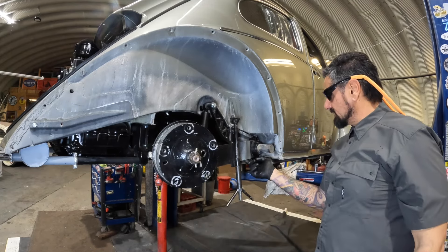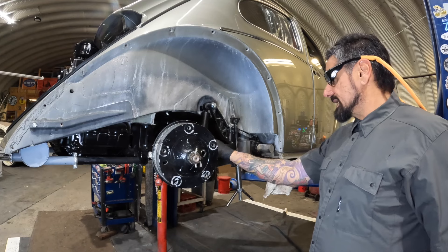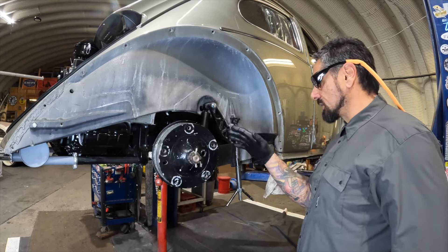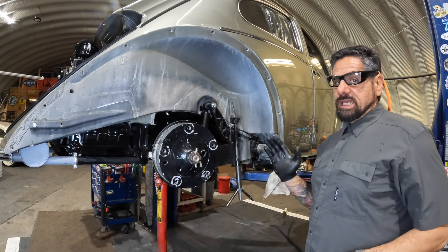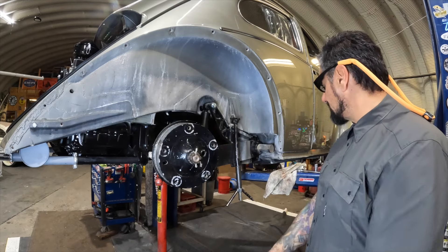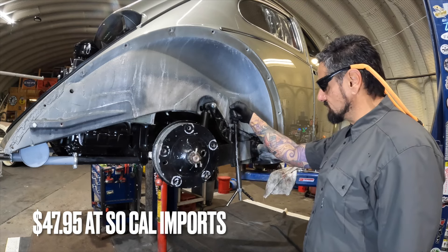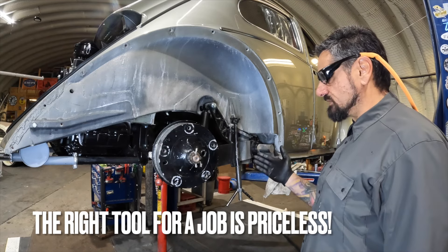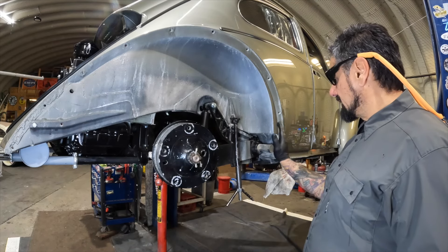We're clear of the housing — it actually takes a bit of effort. You can see it kind of puts a bow in my tool; that's a lot of tension this thing is under. This is a very dangerous point when you're working on suspension, so you need to be really work-wise. This is under tension — if you don't have a tool like this, you can do it with jacks, but I don't recommend it. You're going to hurt yourself that way. You can spend maybe 40 bucks for this tool, and that's the route I would go, especially if you plan on working on Volkswagens.